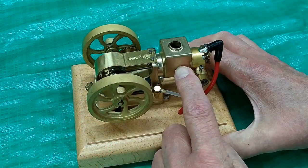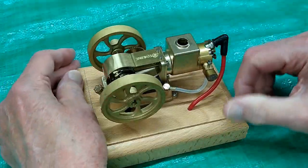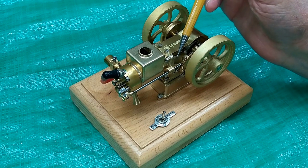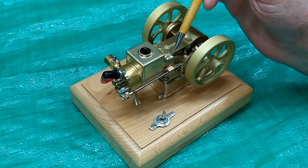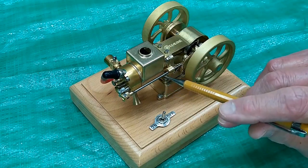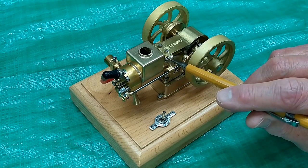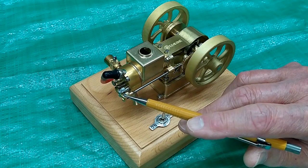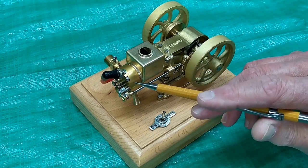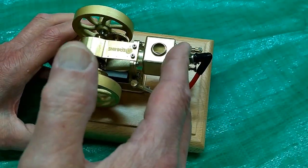It should take off. The water jacket for water cooling is a pretty good size — a little larger than some. The cylinder is held onto this base with studs threaded in here and then metric nuts. The easiest way to replace the O-ring would be to remove these four nuts and slide this off the piston, replace the O-ring, and slide it back into position. The needle valve is one-eighth of a turn open.